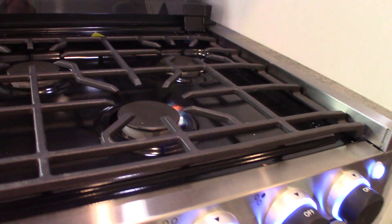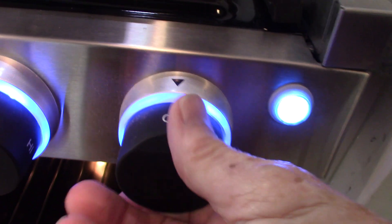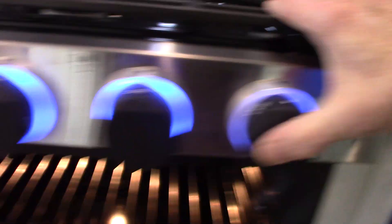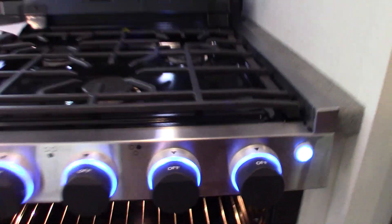Three burners and three knobs. For the oven, there's a pilot light all the way at the back and bottom. Go to the oven knob, go to the picture of the flame — which means pilot light — depress it, keep it depressed while you're lighting. Spark it with the other hand until you see the pilot light light. Once it lights, hold this for another 10 to 15 seconds to heat up the thermocouple. Then go to whatever temperature you want. When you shut it off, the pilot light goes out, so you have to relight the pilot each time you use the oven.